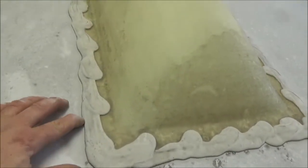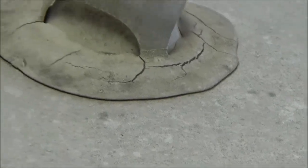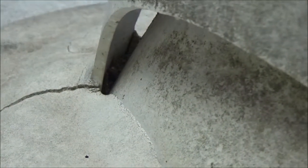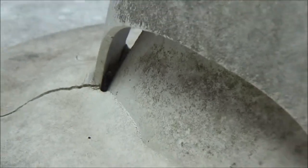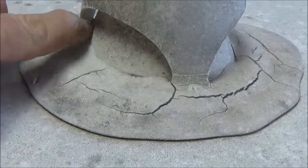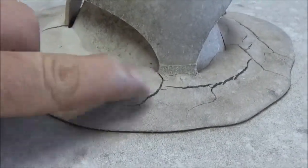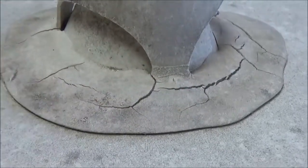Some of the things they're going to ask you to do if they do a roof-over at an RV center is to check all those areas — see all that fracturing. They're going to want you to dob that all up. Right in there, there's no caulking, so the water's going to get in there. Underneath on that other side there's a screw, so it'll roll underneath and that's where it'll leak. They're going to want you to fix all this, and that's out of your pocket.